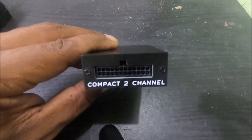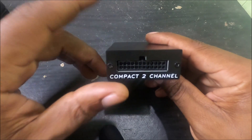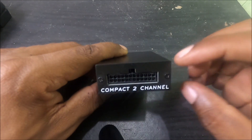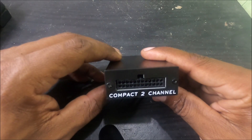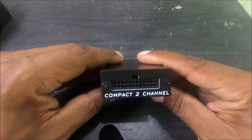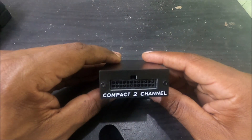On the front or back end there is a 24-pin Molex connector. On those 24 pins we have power, ground, two injector outputs, two ignition outputs, and four high-current outputs. Out of the box the four high-current outputs are configured for idle, VVT, boost, and fuel pump.